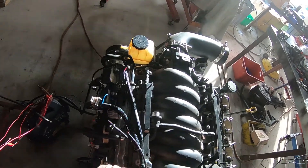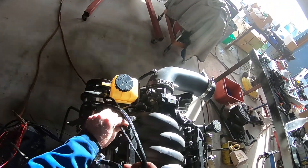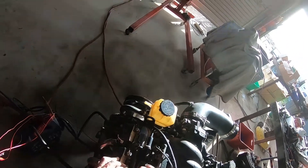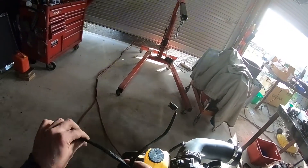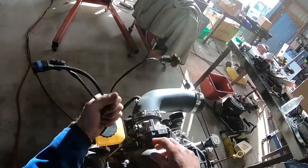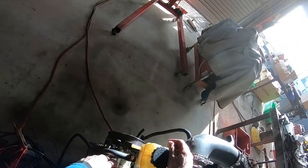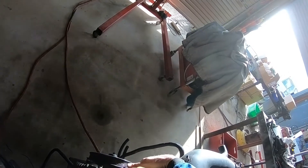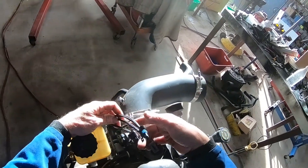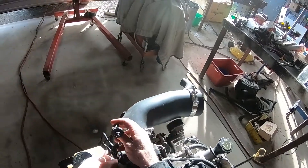So the injectors are down this side. The coil plug — I've put a fireproof covering rated up to 600 degrees constant or a thousand degrees Celsius — going down to the temp sensor. This is designed to go under the power steering reservoir, but if you're putting this in a boat, for example, you're not going to have a power steering reservoir. And I've put an air temp on it — I've used a factory Commodore air temp sensor.